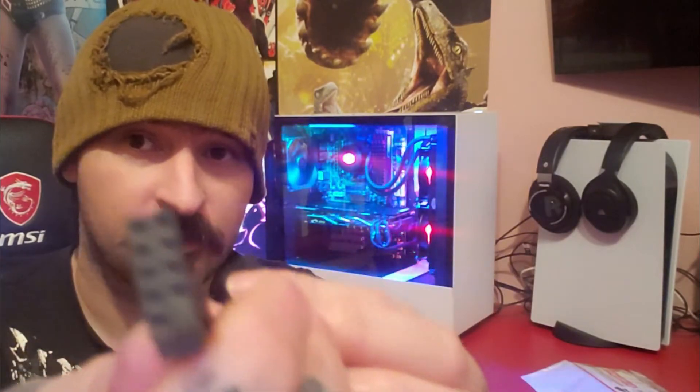Now that you understand the basics — you aren't really getting 3.0 speed, you're getting a 3.0 port turned into a 2.0 — it actually works and you can hook it up. Let me show you how to install it. I picked this up for five bucks; you can get them off eBay, Amazon, stuff like that. It comes in a sealed package. This end here is the 2.0 header to your motherboard, and this end is the 3.0. I'll get this PC moved out and show you how to hook it up.